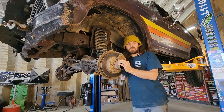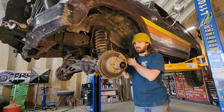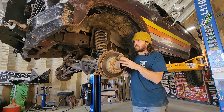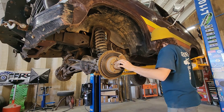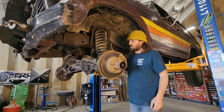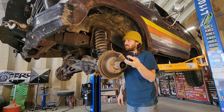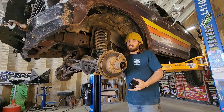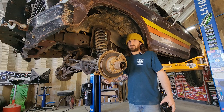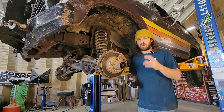I am eventually going to go with the 14-inch coilovers I have sitting over there, but this is my first time building my own suspension like this. I want to add a two-inch spacer to the bottom of the coil. I'm really glad the false advertisement on this spacer comes out to an inch and a half, because I wanted a three-inch lift on this truck. They make a two-and-a-half-inch bolt-in lift, and then a five-and-a-half and eight. I don't like any of that stuff and didn't want any drop brackets — I wanted to go with a long-travel style kit.